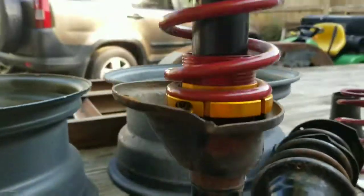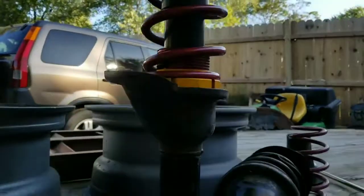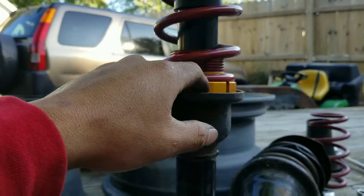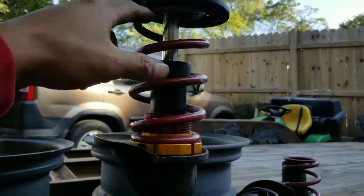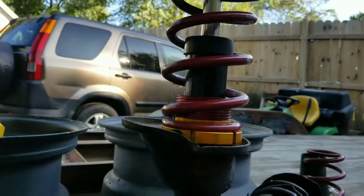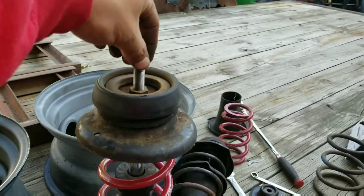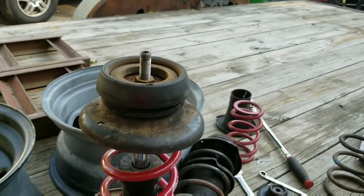If the spring is still too long and makes it look too high, I could always lower the actual sleeve down once I cut this and just leave the cup. To actually lower the car, I'm still concerned about travel - bottoming out eventually. The plan for that would be making a top hat to make this extend up higher so it doesn't bottom out as soon.